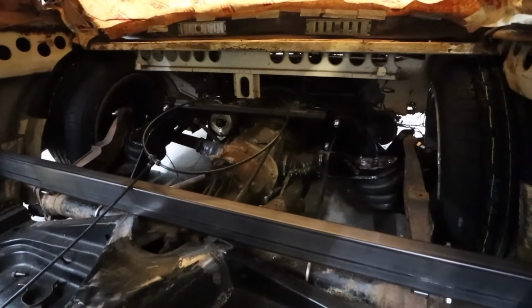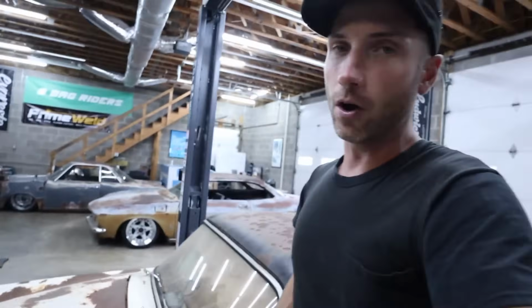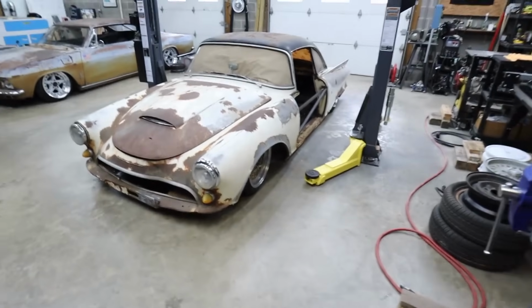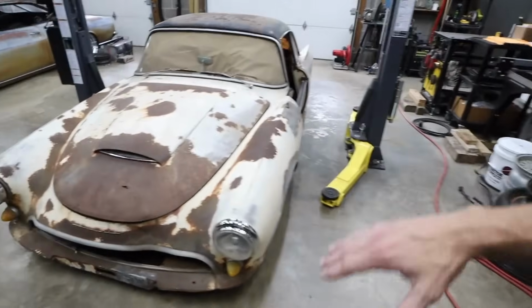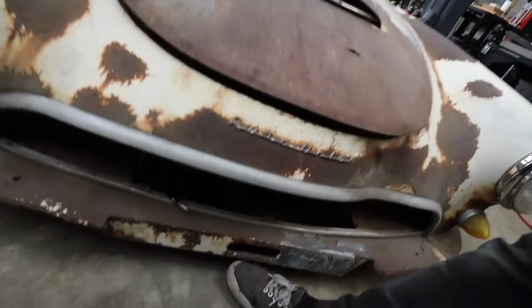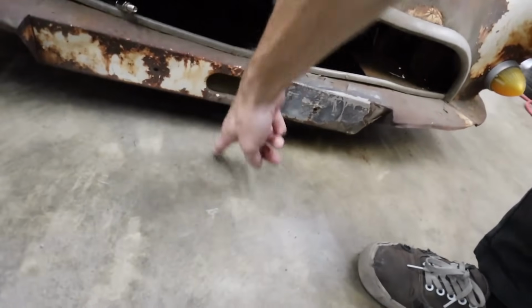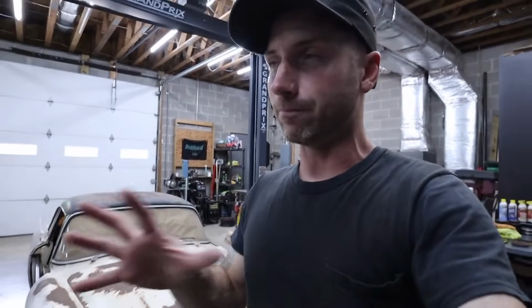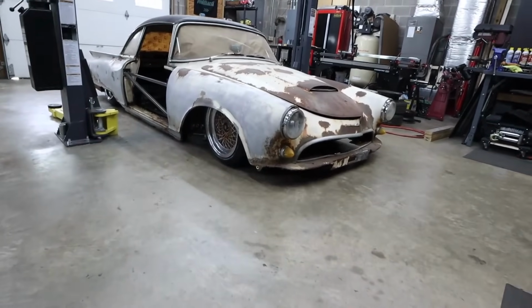We are probably going to work on the rear today, and we're also going to take the pinch welds. That's where we're going to start. Now, I don't know if we're going to take half the sill. I want to, but we are incredibly low as it is already. Pinch welds are laying flat on the concrete, and the plate frame is like, you know, if we raise the rear, this just gets stuffed right into the ground before we lift the front. So I have some figuring out to do there, but we're definitely taking the pinch welds. That way it lays rockers completely.